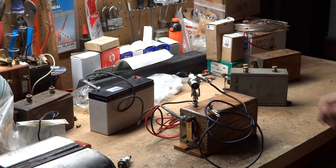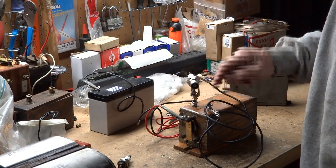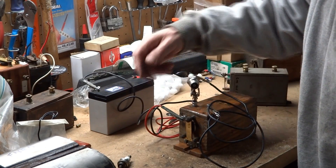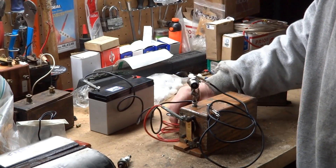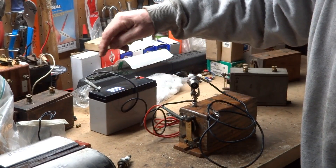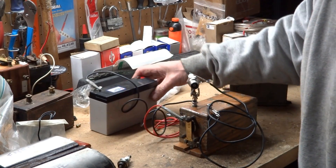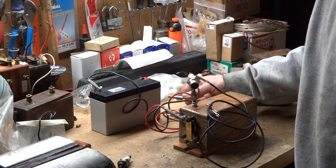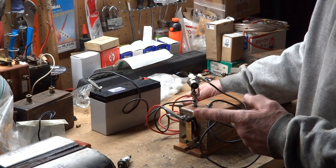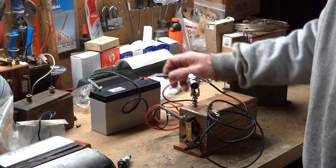I have the first coil set up. I have my test plug connected to the common side — the ground. I have the plug side connected to the plug section on the coil, and I have the battery connected. I'm going to hook up the hot side to the positive post; the negative is connected to the ground or the common side. This is a 6-volt sealed lead-acid battery. I changed the condenser in it this summer and readjusted the points. I also cleaned the front up — this coil was a basket case.